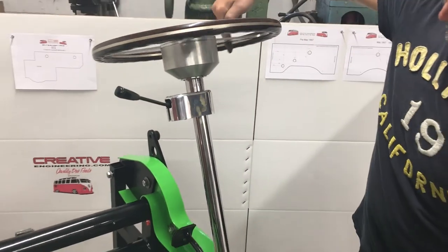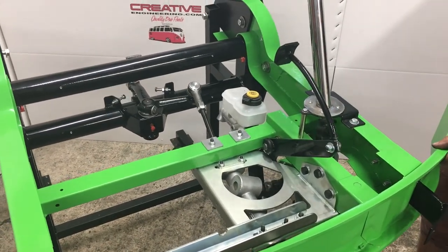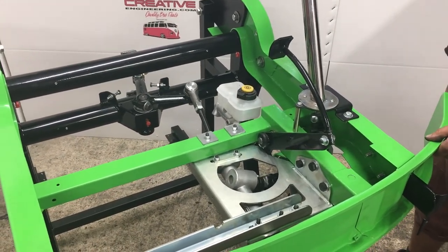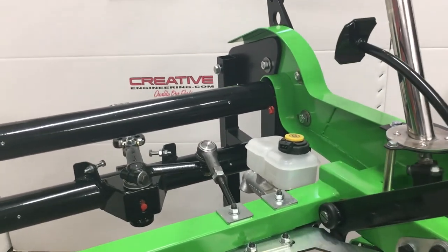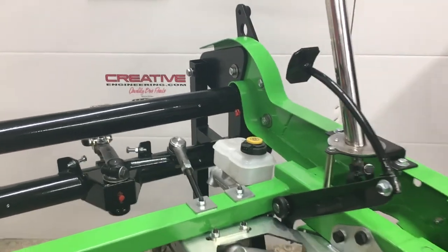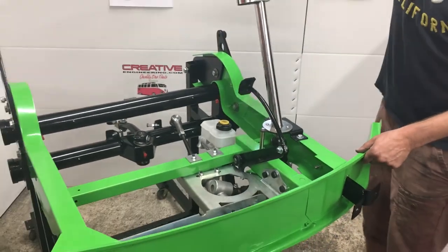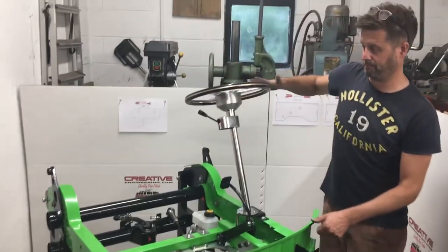Lock them nice and tight with no fear of working loose. We've actually had two customers — or mechanics that worked on the car — replace a 10.9 bolt with an 8.8 bolt, tighten it up, stretch the bolt, and then it can rotate on the splines. That's a definite no-no. As it says in the fitting instructions, the tensile strength of the bolt and the torque settings are vital and must be adhered to. Both bolts are tightened on the UJ, Sean's rotating the steering wheel, and you can see the rack doing its thing — the arm moving, which would pull and push tie rods and give you proper steering. Big smile from Sean.